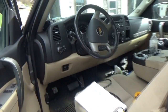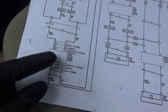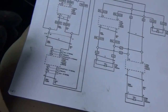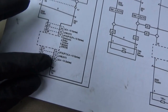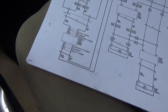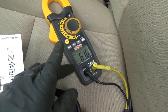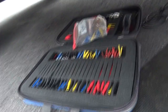Back on this Chevy Silverado with the EBCM that's burned up. One thing I didn't do last time — if you suspect a module, you unplug it; that side of the network came back fine with 120 ohms resistance through the terminating resistor inside the engine computer. What I want to do now is jump pins 24 and 23 — yellow and tan — and pins 37 and 36 — yellow-black and tan-black — and make sure we have 60 ohms resistance. This checks the data link resistor and the rest of the network to be 100% sure this is the only problem. We got 60 ohms — that looks good. Here's the connector with the jumped pins, easy to do with the AES Wave kit.